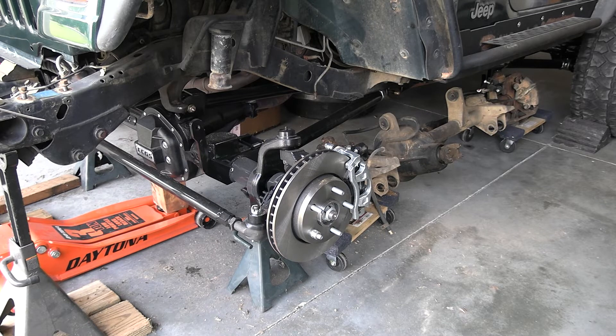Let's get after the meat of it. Em's had this Jeep about three years. She really took her time deciding which way she wanted to go with it. We think it had a two-inch spring lift and a two-inch body lift when we bought it. It was running 35s and it did okay — actually drove really well. But after three years she finally gave me the green light to build it. So first things first: Grunt is getting new axles front and rear — JK Dana 44s. Getting rid of that Dana 35 out of the rear and the weak Dana 30 in the front.